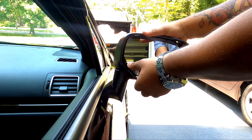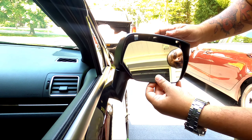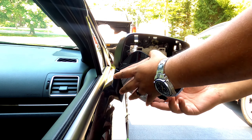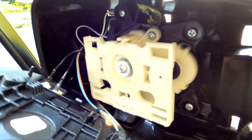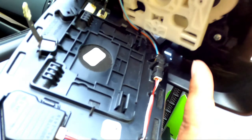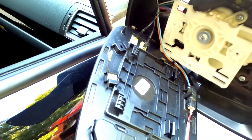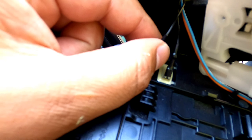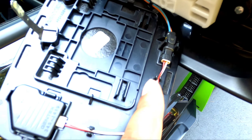Push this all the way in, put your hand underneath, and pull forward gently. Once you pull forward gently the clips release. Let me show you on the inside — these are the tabs below here. It plugs in and snaps into here, and these hooks right here hook in like so. Now these are your defroster connectors right here — those you're going to take out.